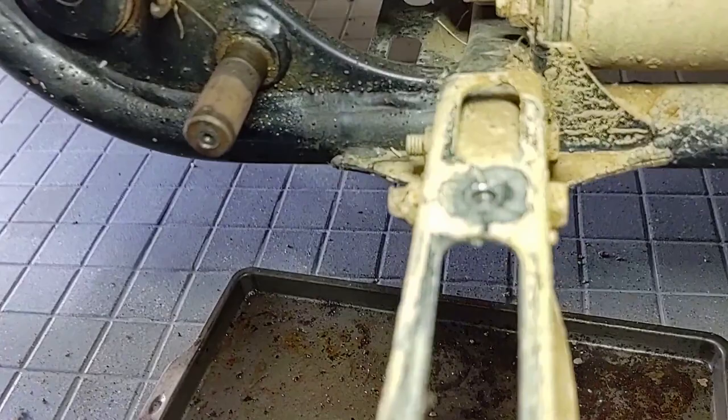I've been trying to use a combination of a toolbox toothbrush and a little battery terminal cleaner to try to get in there, but I'm really trying to take care of that seal because I don't have any replacements. I thought before I cleaned them off that I'd be able to pop them out, but I grabbed hold of them and they did not want to give. When I wiped them off I found they appear to be reinforced, pressed-in grease seals — they definitely feel pressed in. So do yourself a favor and order a couple.